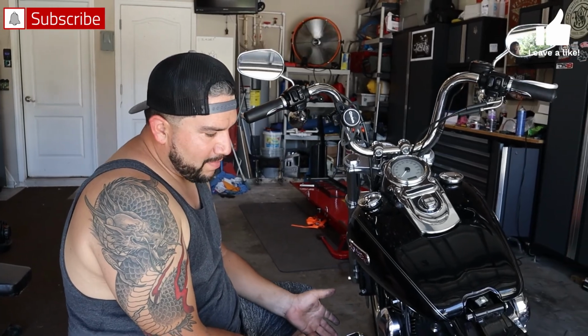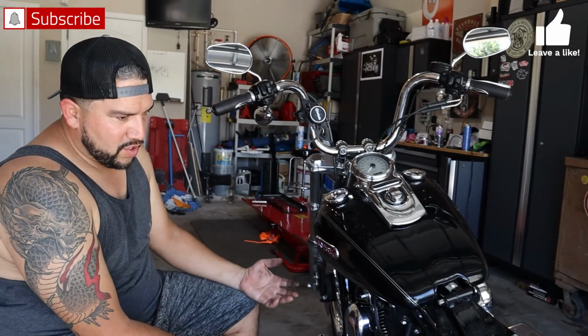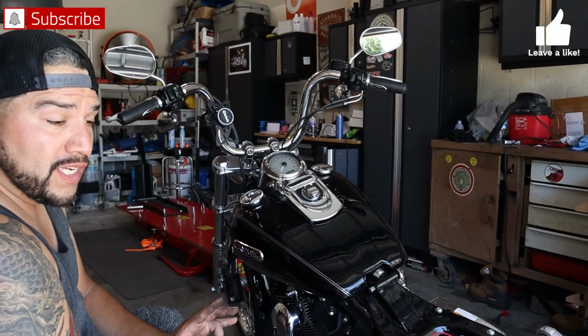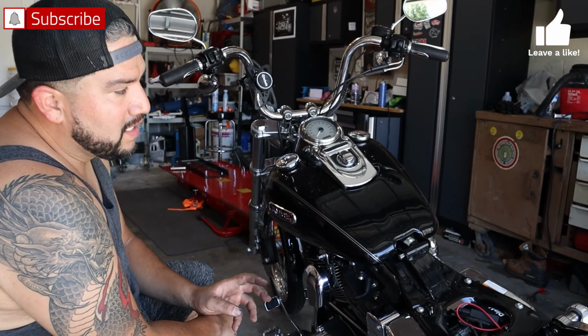All right, so I got everything back together. I just basically reversed everything I did. So to sum it up, we changed spark plugs, which I don't think it needed. I want to say one of the injectors was clogged. It wasn't misting, it was kind of spitting.